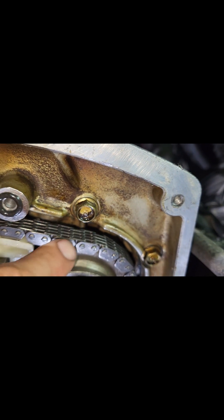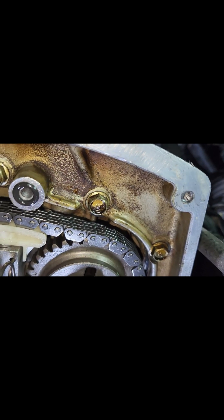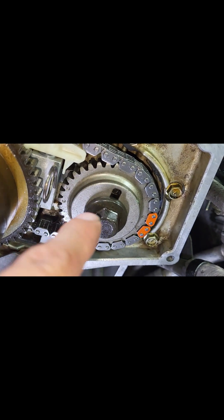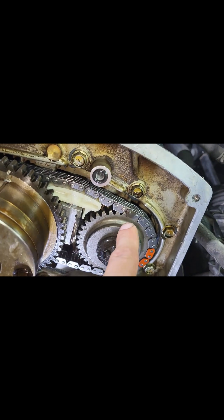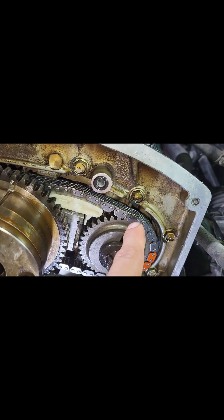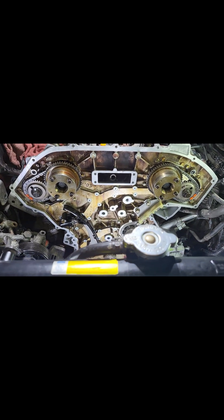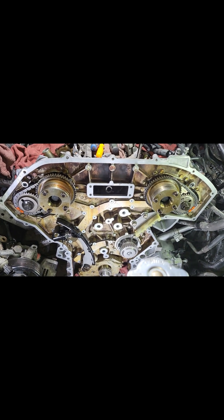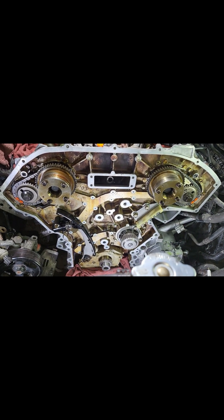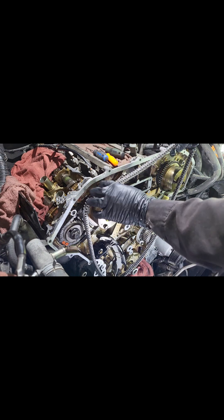You can see that line over there. Line that up. Like I said, when you have the sprocket out, the dowel on the camshaft should line up to that. That's the timing marks. Now I'm just gonna put the main timing chain on and see what happens. I got the chain right here — there's the dark links right there, it's a black link.